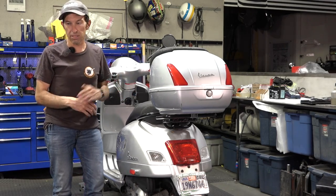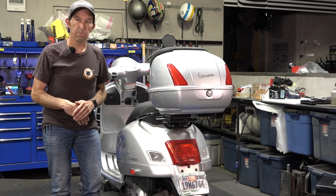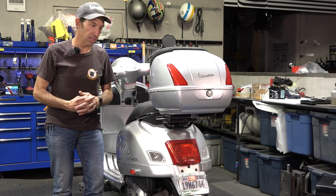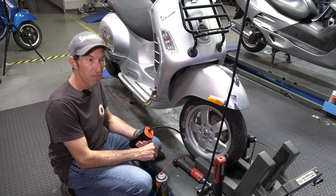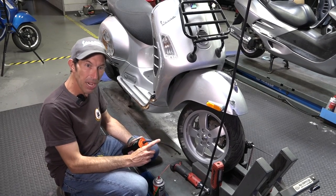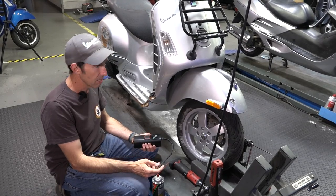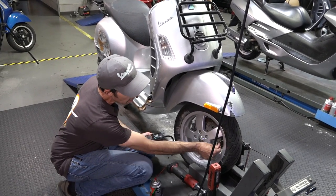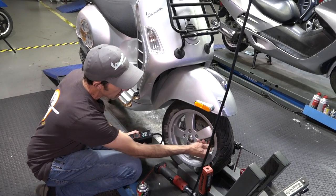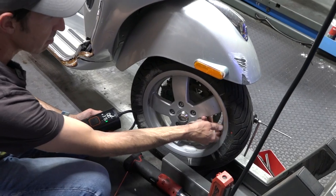It's got fresh tires, but I want to check the fluids, check the tires, and do some basic upgrades. I want to share that with all of you. Every scooter owner should be checking their tires — preferably every ride, but at minimum once a month regardless of how much you use it. Always check your stem, give it a little push, make sure there's no cracks and it doesn't want to pull out. That's a fresh stem because I put that in there.